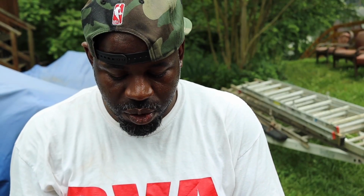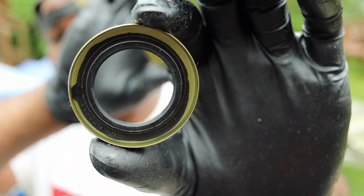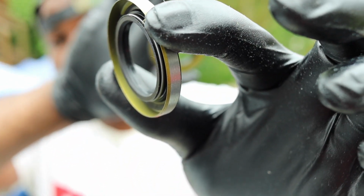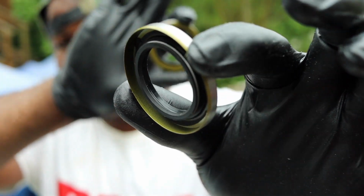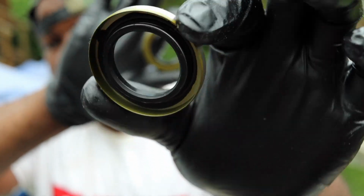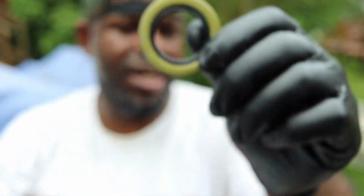I just ordered some new seals, double lip seals for the rear. So these are for the rear. You see that spring right there? That's to hold tension around the axle so that no grease will come out the backside. But these are brand new. I think I got these from like Boats Plus or something like that. Like I said, all this stuff will be down in the description.